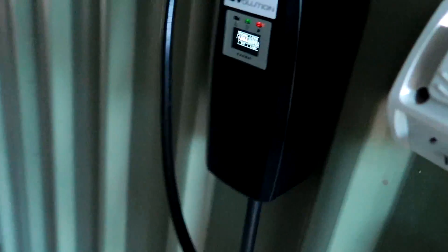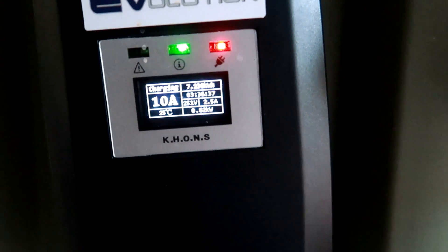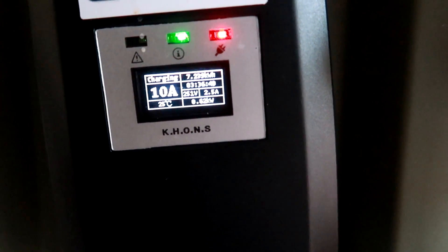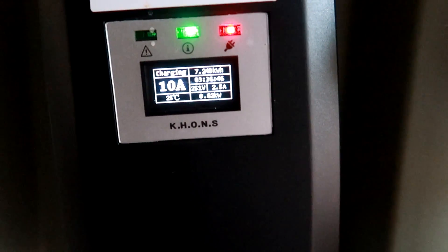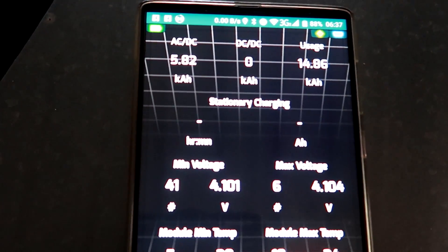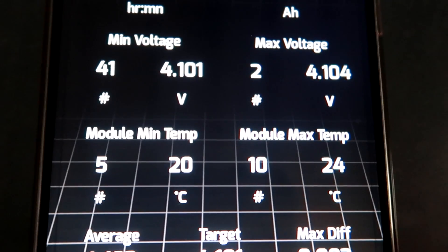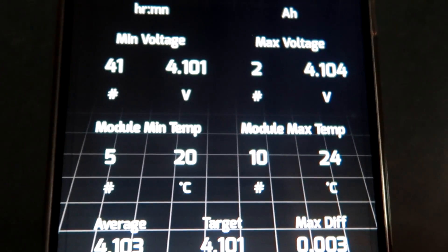Good morning — welcome to 10 amp morning. The SonOff app shows we are charging with 600 watts only; it must have just finished or is about to finish. So far 7.23 kilowatt-hours, three and a half hours charging, with 2.5 amps at the moment. We are at 100.3% state of charge.